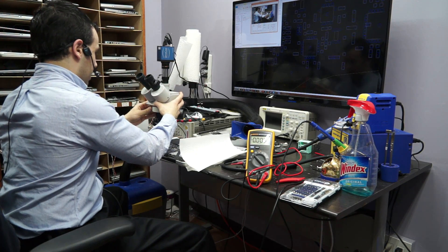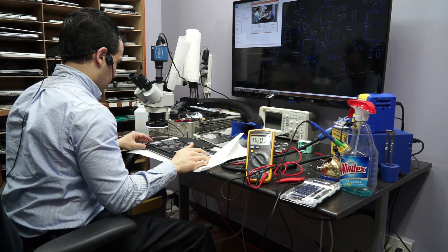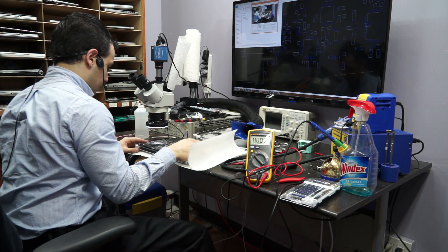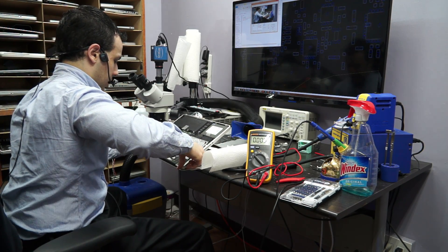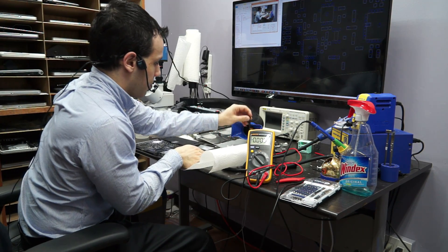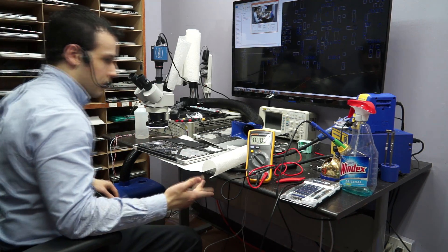I don't tell people same-day even if it is a backlight issue, because that makes life a nightmare — a hell for yourself. So we're going to go through fixing this. First thing to do is take some measurements and check out why this is messing up. Since we have that voltage on backlight, obviously the fuse is good.